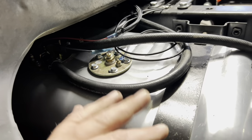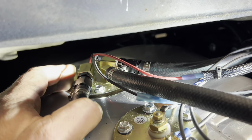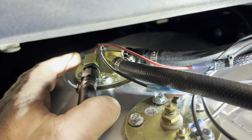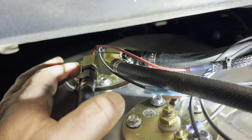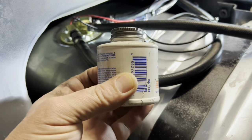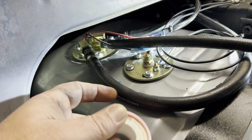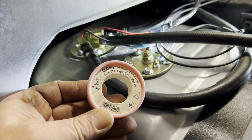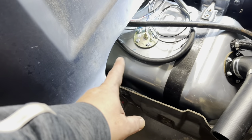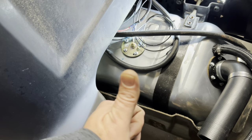After the last video when we shut the truck down, I looked underneath — gasoline everywhere. It turns out these AN fittings that went into the brass fittings were leaking. When I put it all together, I sealed it with this liquid thread tape stuff. Turns out that doesn't seal. So we took it apart, cleaned it all up, and resealed it with this pink extra duty, extra thick, extra heavy stuff. I've run the truck since then and no more leaks, so I'm going to assume that this is all fixed up.